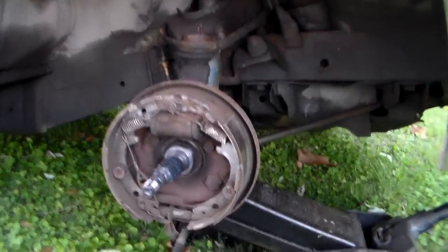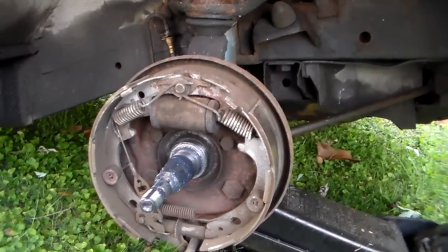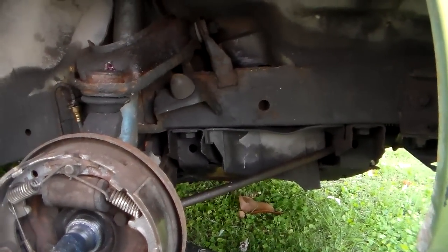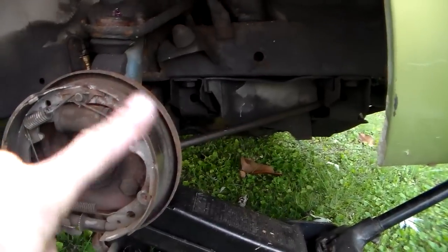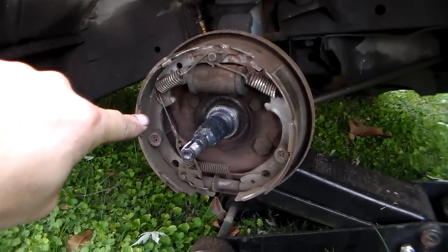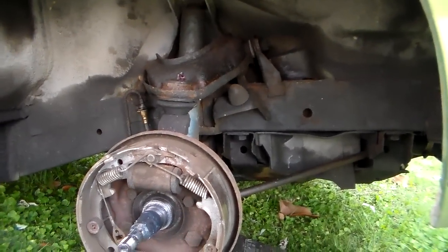Back to the brakes on this Plymouth — I think I found the culprit. I've got the right side of the car apart. I stuck the wheel back on and did a couple of tests to get some evidence about what was going on. First, I wanted to see if both brakes were actually functioning, so I put both wheels on and spun each wheel with my hand up on the jack as fast as I could, then popped the brakes — and it did work, it did slow down.